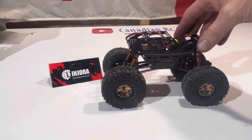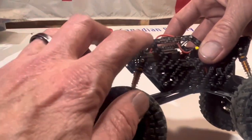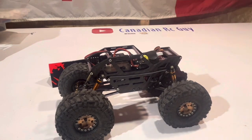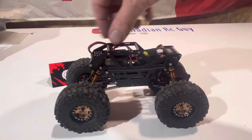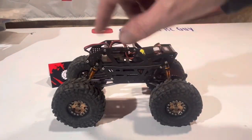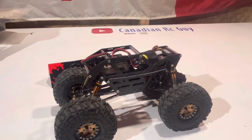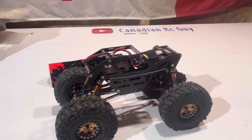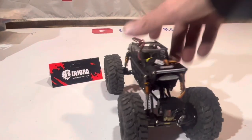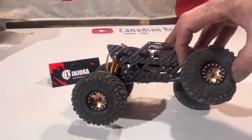We've got it all done. We did end up moving the battery to the front and the ECU to the back — unfortunately with our on/off switch up front there was just nowhere to get at it, so we swapped them. We've still got some wires to run; not exactly sure how yet. Shocks are set up and there are tons of different hole positions to use. We've got lots of great flex, and it should give us a better steering angle than before — same great flex at the back too.